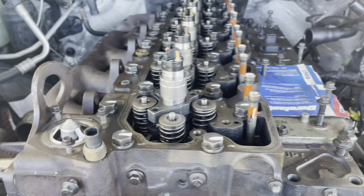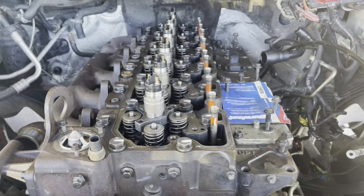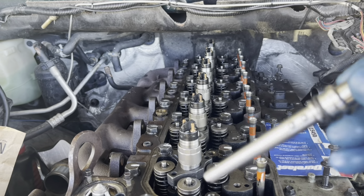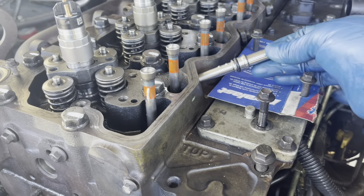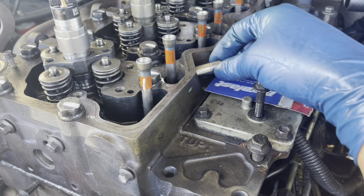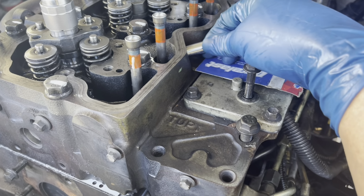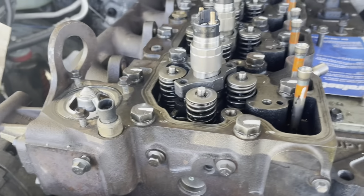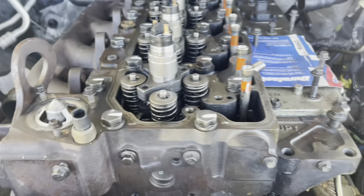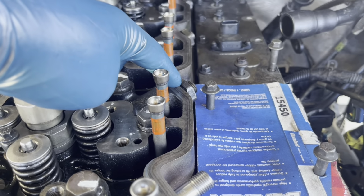And then for another side, on the side of the head, this is the pipe fitting, diesel to the injector. They got one position. You see these two little bolts on the top, there is a groove, and they got the O-ring. So you turn a little bit, and then push it in. And after that, you put the nut to keep on place and you tighten. Like this.